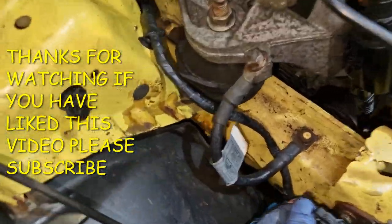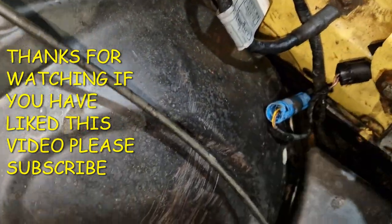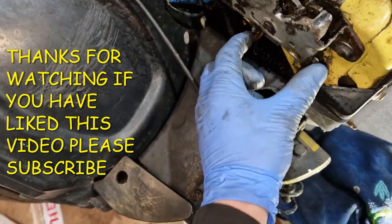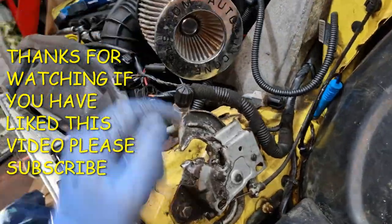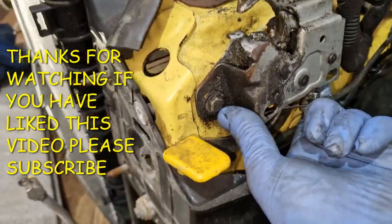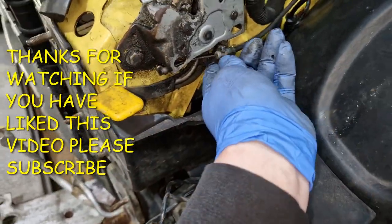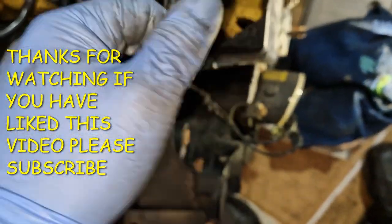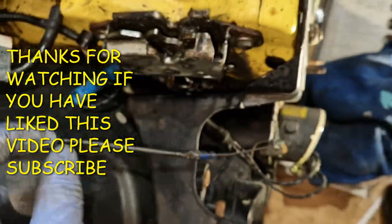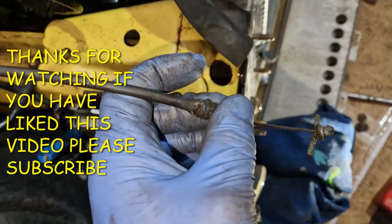We've got the fan all back in. Looking at the bonnet to see what happened — it was always working, but this wee bit seems to be broken off, so the tab's obviously broken. That just senses that the bonnet's closed. The actual latch itself — when you pull the cable, it pulls forward and allows it to release. It's a dual cable, dual latch system. The cable is seized, so I'm going to need to get a new one — it looks pretty rotten in there. It's been here a long time.